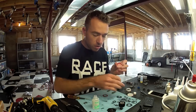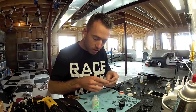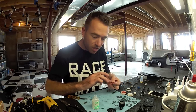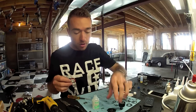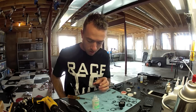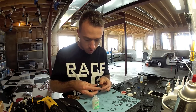I use a gasket sealer — just get a little bit on there and put it on both sides. This will help seal it a little bit. The main thing when diffs are leaking is it's normally not on the gear side, it's on the other side — it comes out by the bearing. And normally that is just because the diff was too full. Filling it up properly helps with your diff not leaking. Got the gasket on there, line up the pins, push it down, and the screw holes are all lined up.